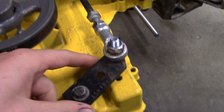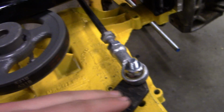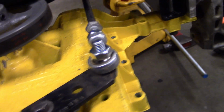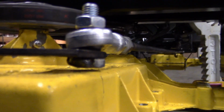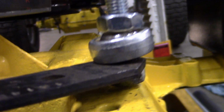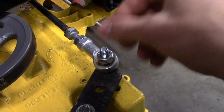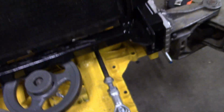I took one of these shifting arms, and usually they're bent up right about there where you can see that black line. So I heated it up, pounded it flat, and then I took another one of these bolts, stuck it up that way, welded it on behind it, and then I kind of have something to set the heim joint, and then thread the nut on.